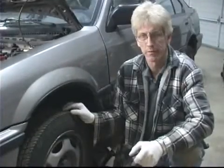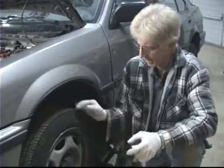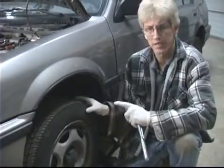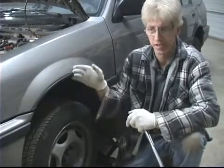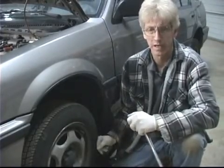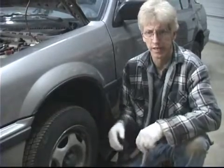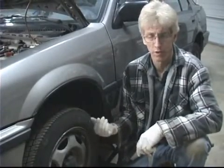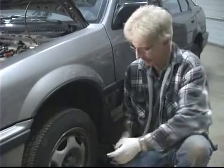In this segment, we're going to cover removing the wheel and locating the access point for the lower crank. We only jacked up one side of the vehicle, so because it's automatic transmission and the other wheel's on the ground, this wheel will be locked up while it's in park, so we'll have the ability to break the lug nuts free. If this had been a manual, or if you jacked up both front wheels, you need to break the lug nuts free before lifting the vehicle.